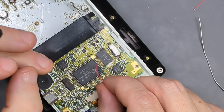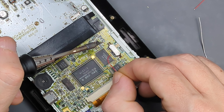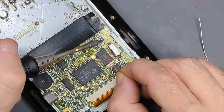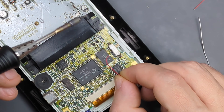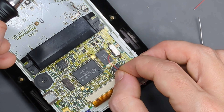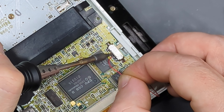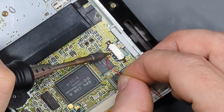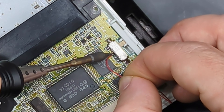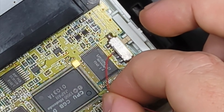You could add a little more flux at this point if you weren't sure about it flowing. Now it's the same sort of process as before — heat that blob, bring the tip of the wire into the center of that blob, move the heat away, and give it time to cool. Hold fairly close so you've got control over what you're doing, but not so close that your fingers risk getting burned. Heat the blob, allow the wire to merge with it, make sure it's in the right position, and then move the iron away while it cools.